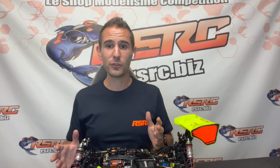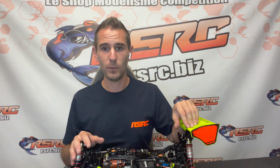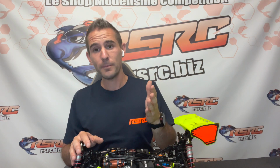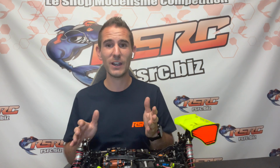You should find your comfort zone. For myself, I use 2.5 tow-in in the back of my 1/8 buggy, but your comfort zone might be 3 or might be 2. So go to the track, give it a try, and let us know.